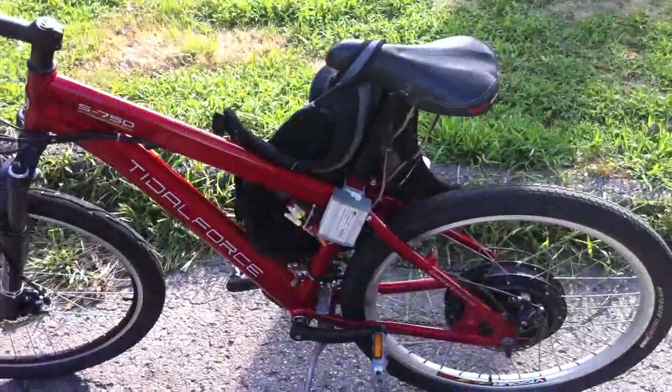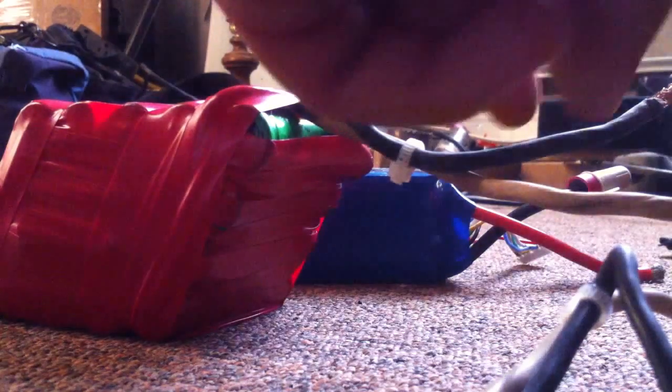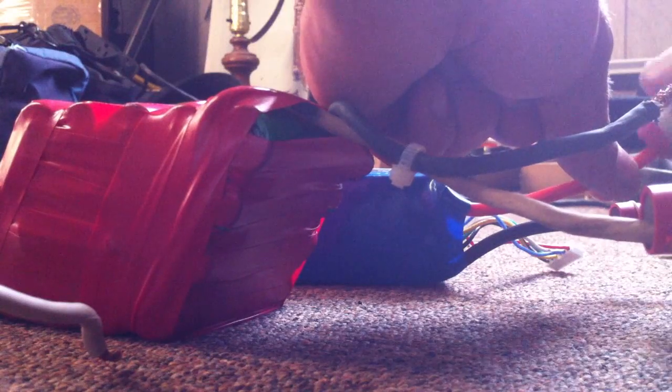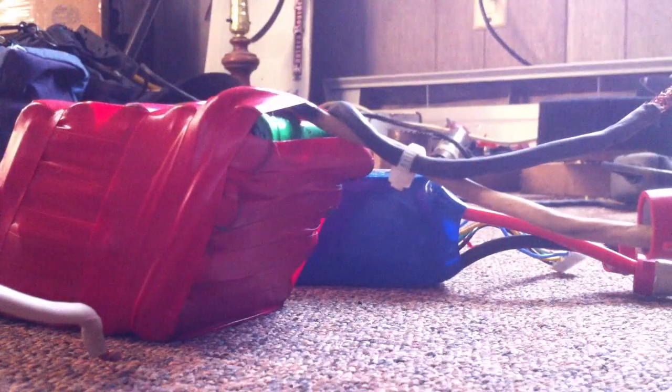I definitely need to buy a new controller — that thing's just tiny. After getting back from that ride, I want to split these packs apart and check the voltage differences between them. The first pack is reading 19.57 volts, and the second one says 20.22 volts. That was only a two to two-and-a-half mile ride, but it was all up steep grades, and I was trying to test whether the controller would cut out — and it didn't, which was good. But imagine if I put a deep discharge on these and the controller didn't have a low volt cutoff — I could definitely damage them.